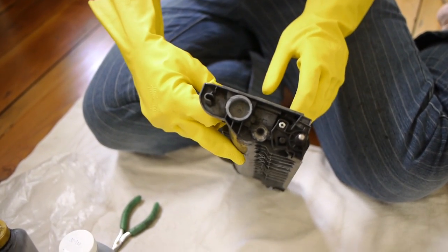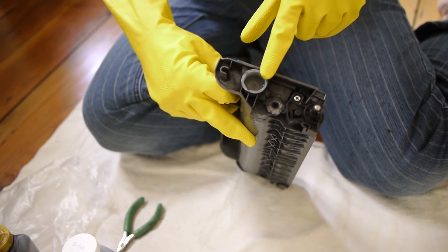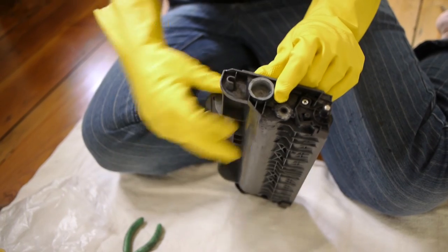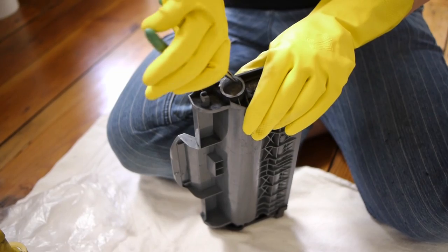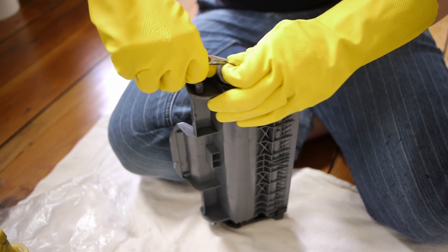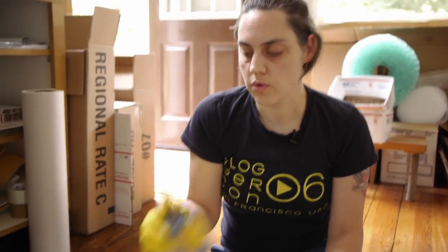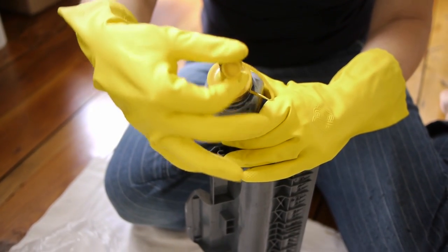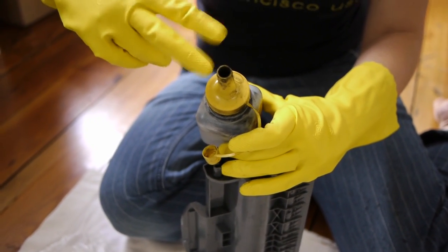The first thing you want to do is there's a little cap here that holds the toner in, and you want to take that off. You could use a flathead screwdriver, or I'm going to use a pair of pliers — you just have to really get it off there. It's not always easy. The powdered toner kit should come with a little nozzle too so that it's easier to get the toner inside the cartridge. Some caps you take off, and some you have to cut off with scissors.